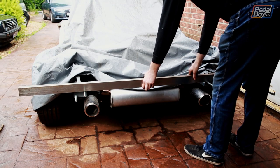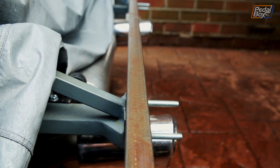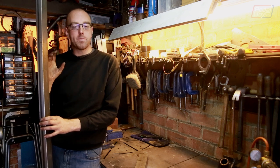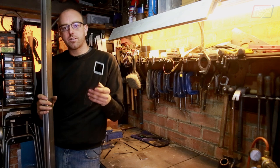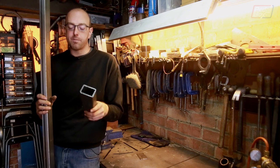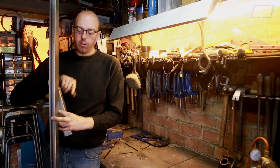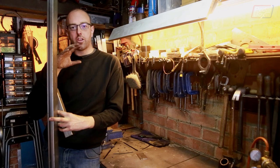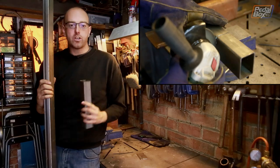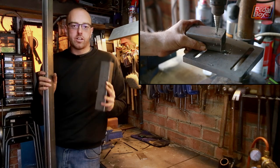This is what we're going to make the rear bumper out of — this is 60 by 30mm box, and we've used quite a bit of this on the car. It's nice and strong and not too overkill. We could go with something much deeper but that would be far too heavy, so instead we're going to use some 60 by 40mm box. Thanks to Berkshire Metals for giving us this out of their scrap bin. I'm going to cut this into two smaller pieces and weld it onto the bumper bar, then drill through all of this so it sandwiches onto the studs on the back of the car, bringing the outside edge closer up to the exhaust tips.